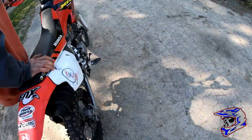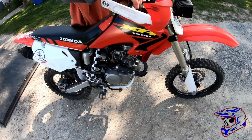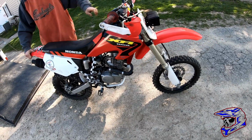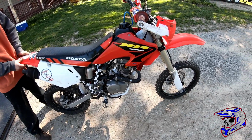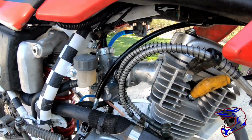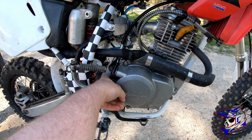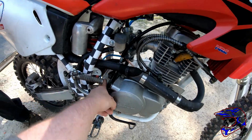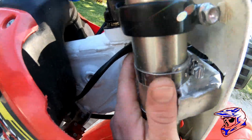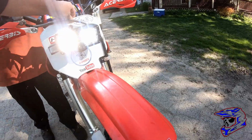The motor itself is 120 cc's big bore with an oversized oil pump, oversized head with huge valves, hot rod camshaft. It's got a cooler there, custom welded intake. I mean, the whole frame's custom. I TIG welded this piece back here. See that rear motor mount? I made it completely, all TIG welded up. I got my name on the frame right here, Southern. I TIG welded that.